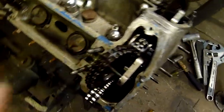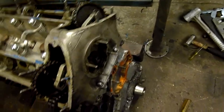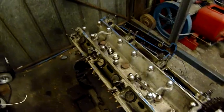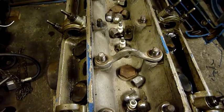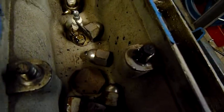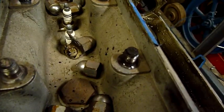I've just got to get these sprockets out so I can reattach them to the camshaft, get the rest of the chain out, and try and separate that head. I don't like my chances, but we'll give it a shot. When coolant water is exploding out from under the nuts on a cylinder head, you know you're probably going to have problems getting it off. This is going to be interesting - definitely had coolant getting into the cylinder head stud through holes. There's some copper anti-seize on some of these, but God knows how long ago they applied that.